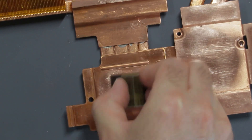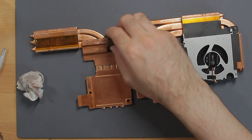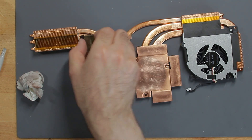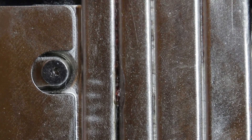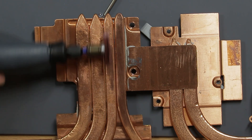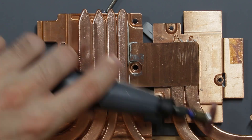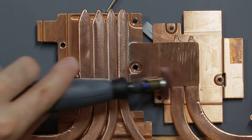This area is surrounded by small copper walls which make the sanding job a nightmare, but still manageable. Now if you want to apply a nickel layer to your heatsink it needs to be super clean. That means you have to remove all stickers and other residues which are not copper or solder. If you miss some spots you will see defects after the nickel plating is done, like those ones for example. Also, just because commercial nickel plated heatsinks are shiny and have a mirror-like finish does not automatically mean the nickel layer is responsible for that. If you want a shiny surface finish, the actual copper needs to be shiny before nickel plating comes into play. To make my copper heatsink a bit more shiny after the rough handling in part 3, I used a Dremel.